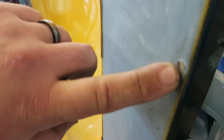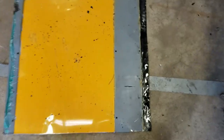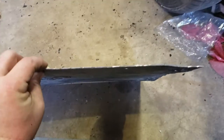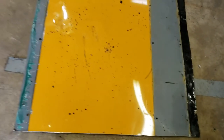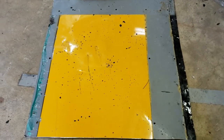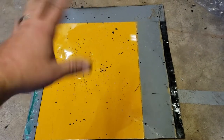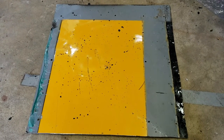As you can see, it's got a 90-degree bend to it right here, so we have to flatten that out as well and use it as part of our floor pan. A few hammer blows later and we now have a roughly straight piece of sheet metal that we are going to use as a floor pan. Let's get this mocked up in there — maybe have to hammer it around, get the shape that we need, and then start tacking and welding it in.